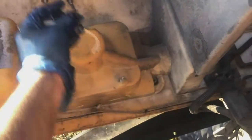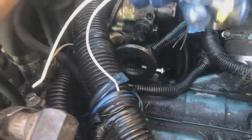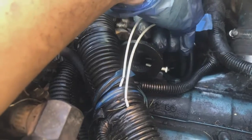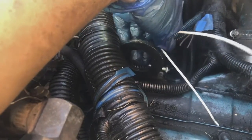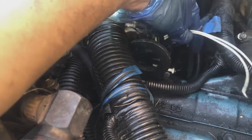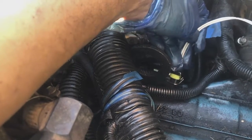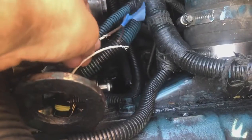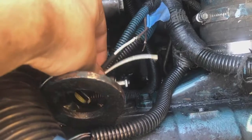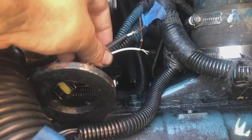So the first thing I'm gonna have to do is peel the end of these cables, and then make this a little shorter. I don't need that much cable, and peel it too, and put it back together, solder it, and put that shrinking plastic, and we're good to go. We'll try it out. Connect this to the IPR, put everything back together, and try to see if it starts. Let's get it together. You have to do obviously your pull test, and then I just wanted to remind you that before you do this, you have to put your plastic in.